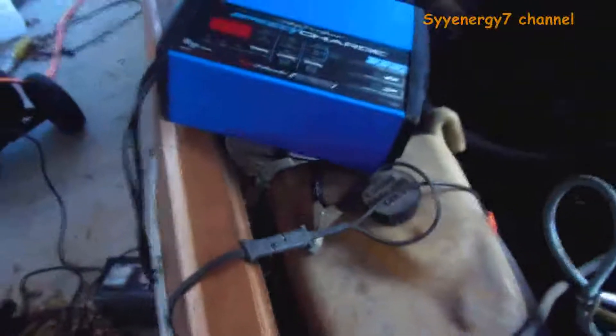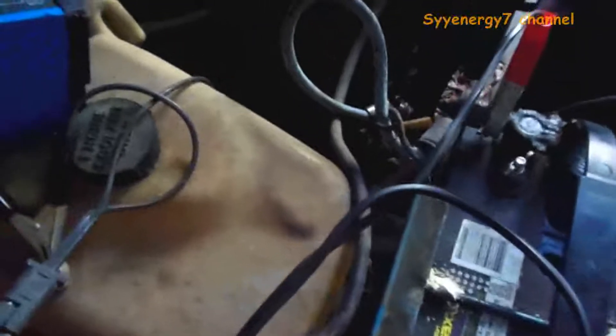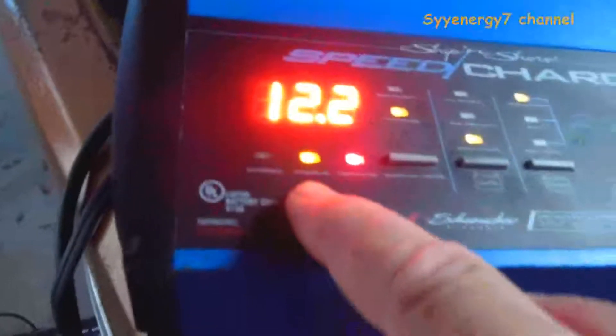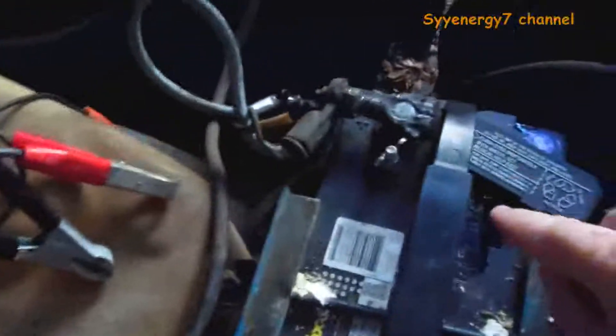What I was trying to do is bring it back with this battery charger — this is a ship-to-shore charger. I'll connect it up and it shows you the volts — about 12.0 or 12.1. It usually starts the car, but this battery does not handle the load tester well. I charged it up a couple of times, and when you try to fast-charge it goes into desulfation mode — starts blinking. But it did not bring it back. So I'm going to use a manual charger instead.